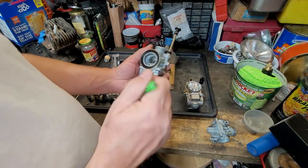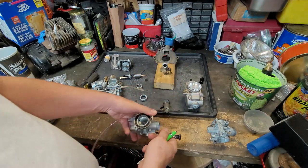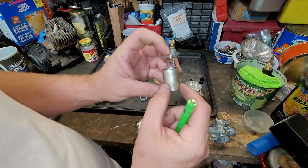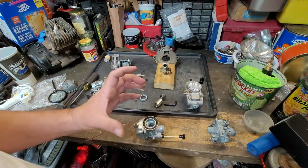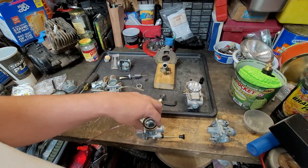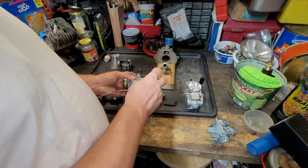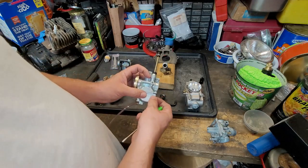When this hole right here is wider, it's using more of the slide — as opposed to using just a small section of the slide, it's using more of it, and that's what you want. You want more air flowing through. Now to accommodate that air flowing through, you need to have a good sized jet. More air flowing through gives you more power.